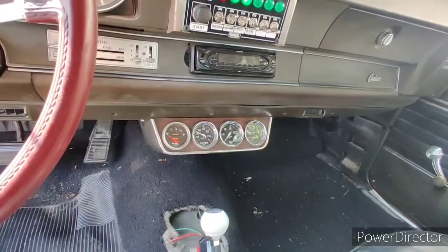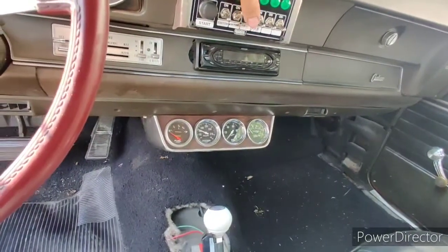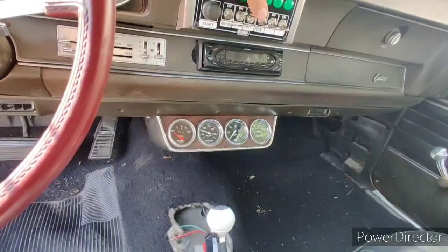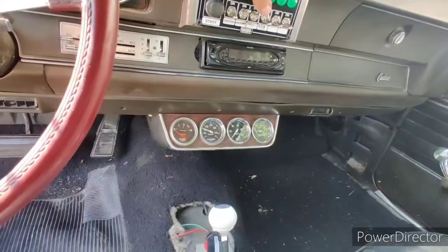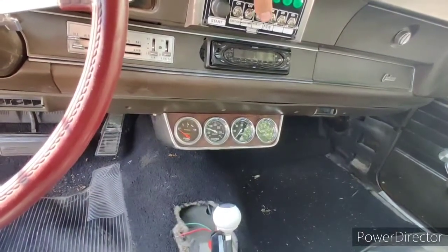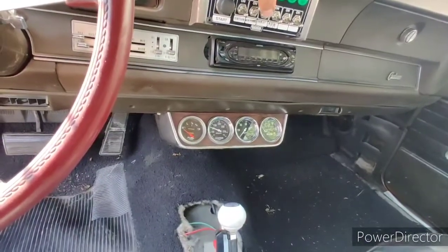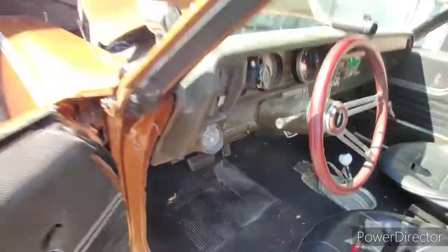And it should drop down to about 180 at minimum because we were cruising around at about 180. I drove it this morning, just to get some heat into it so that way we can set up the carburetor properly, as you always should. Obviously, it's been heat soaking for 5 minutes, so it's a little above 180, and with no real air moving in front, it's going to stay that way.